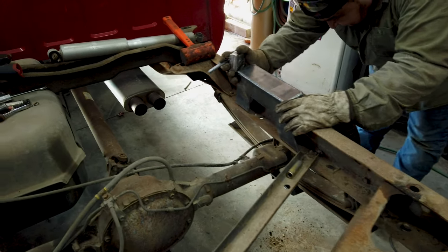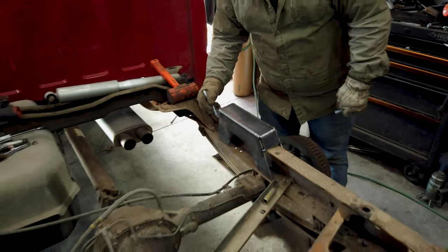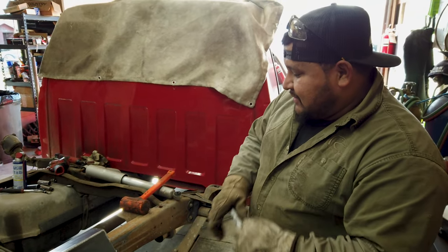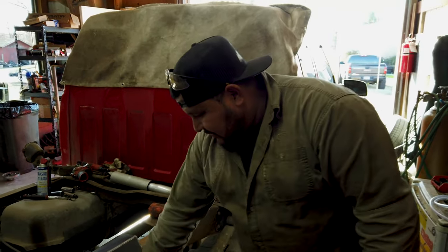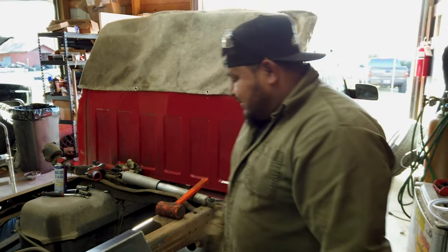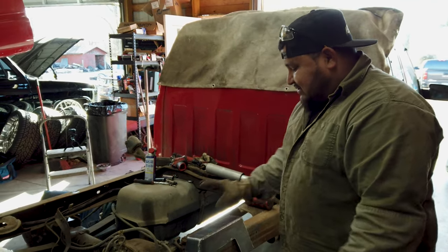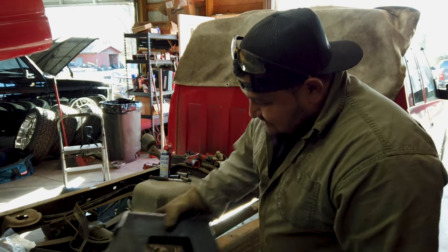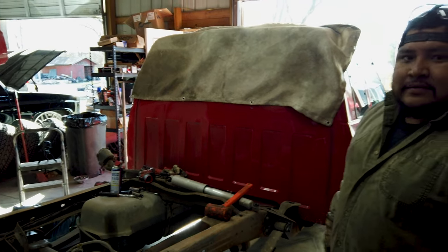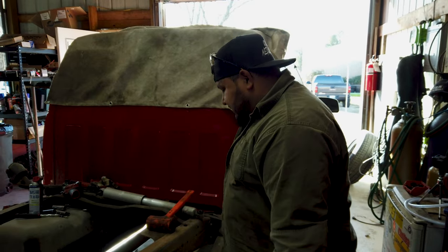Eric's sizing up this custom-made C-notch, so he knows where he's gonna have to cut on the frame. We're gonna cut a lip so we can slide the notch in there. And we won't cut the frame until after everything's welded on. Then we'll just cut this up, but that'll just be scrapped and there won't be any structure issues. Like it won't bend or anything, because it'll be solid after it's welded. Yeah, so you're putting it on there, getting it all stable and solid first, and then going back and cutting. And then the last piece is just a stiffener, basically. Oh, I gotcha. Dude, that's legit.